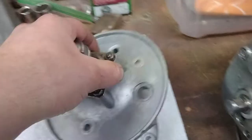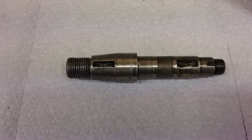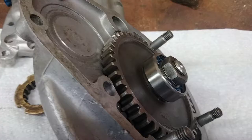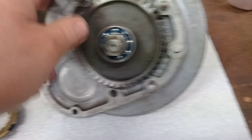This rear plate, which contains the gear for the final drive, has to come off as a complete unit first. The bearing enters from the left in the photo, then this slides through the bearing and everything else is mounted on the right side. So this has to be fully assembled to be installed and it has to come out in one piece — it's not initially intuitive.